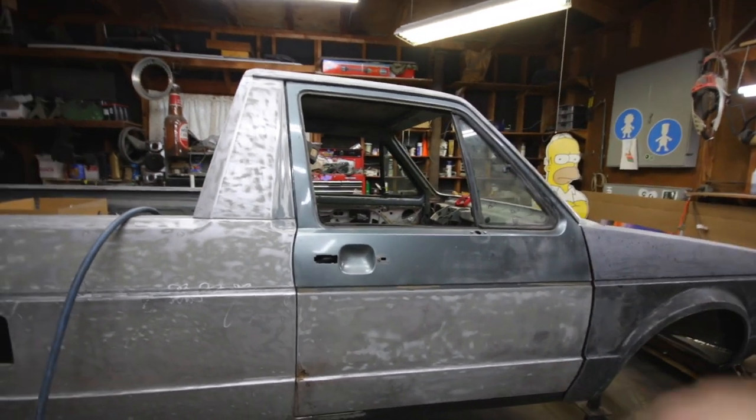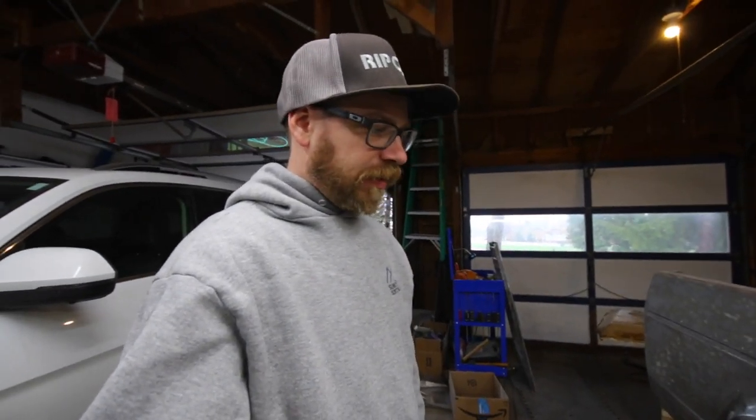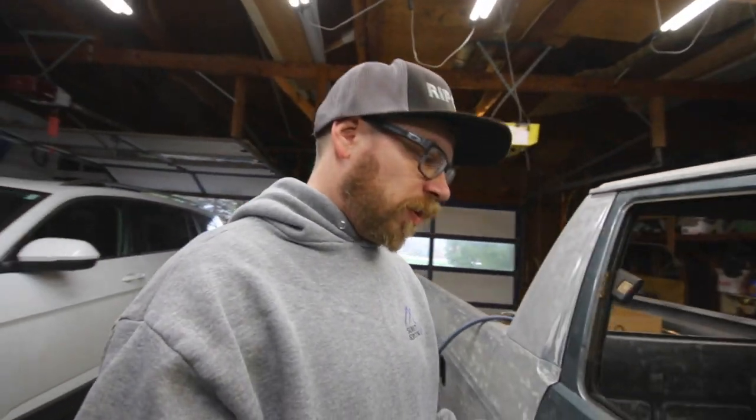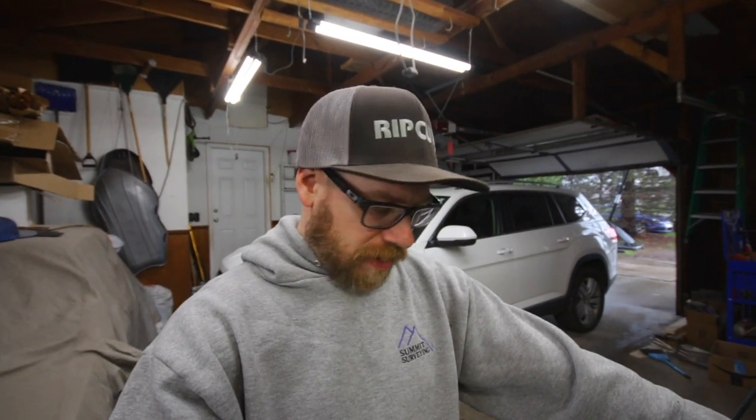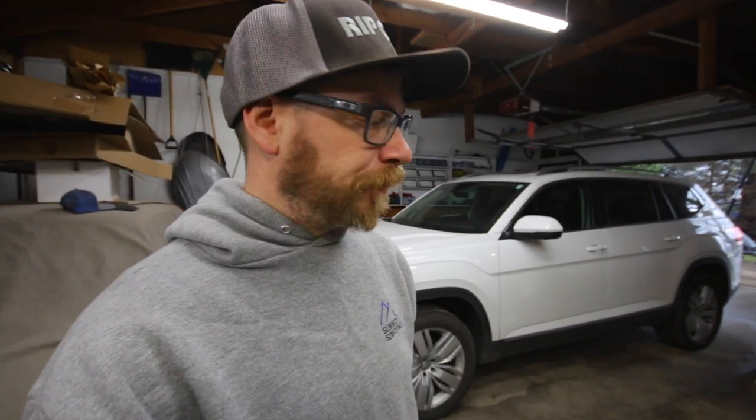I still need to do a lot more sanding to get ready for epoxy primer, finish fixing and sanding the doors up and around, and sand down the fenders to make sure they fit good. I need to order some epoxy primer — I'm going to go with the SPI epoxy primer. Then I'll fill all the areas I need to fill and do some high build right after that, hopefully within the recoat window. If not, no big deal — just sand on it and do whatever over the top of the epoxy primer. Thanks for watching, I'll see you in another one.